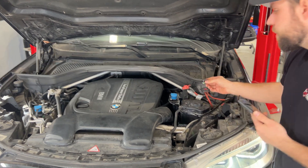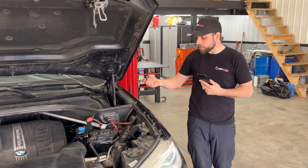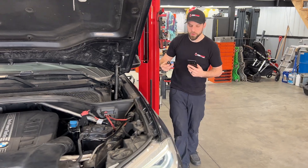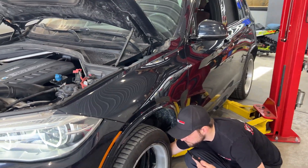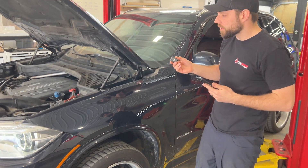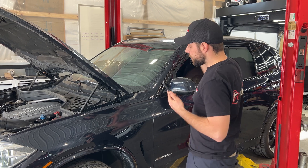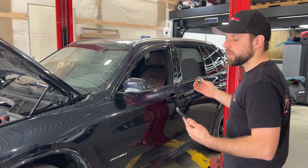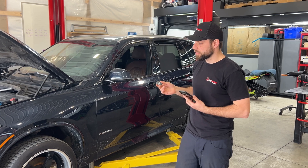This is exactly what a stretched timing chain sounds like on your BMW diesel. I'll put the mic down below too so you can hear what the underside sounds like. It has a very rhythmic tone to it — yeah, this is no good. This is a bad timing chain. It hasn't snapped yet, which is a good thing — we caught it just in time.